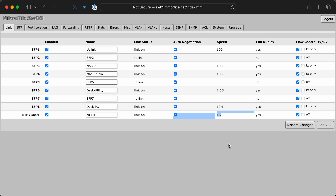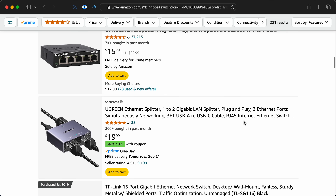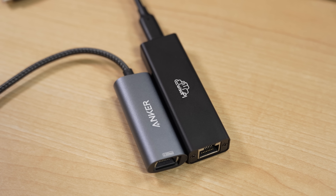This thing doesn't get hot because it's only 1 gig, but 2.5 or 5 gigs would probably get a little hot. That brings me back to the WizPi adapter — 1 gig, 2.5 gig, 5 gigabits. One gig gear is available at pretty much any price point and any kind of design: fanless things, cheap boxes, big boxes with lots of ports. For most people, 1 gigabit is still plenty fine. But it is nice to have the ability to go up to 2.5 or 5 gigabits if your network supports it. The fact that this is about the same size as 2.5 gig adapters — just a little bit bigger — means I can throw it in my bag and always have the fastest Ethernet available.